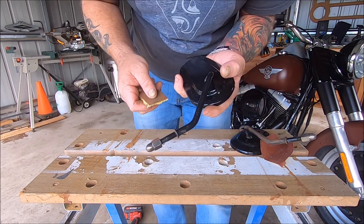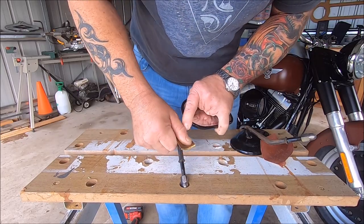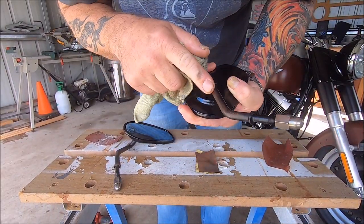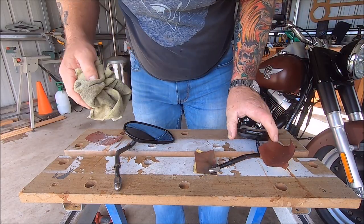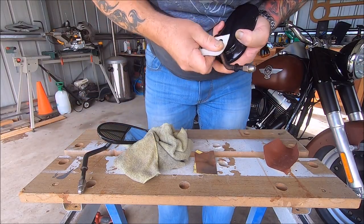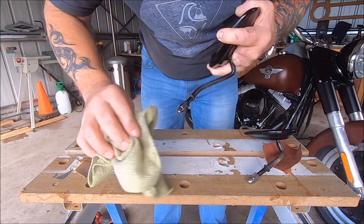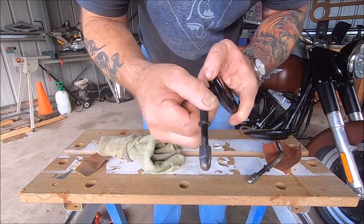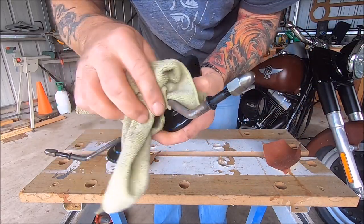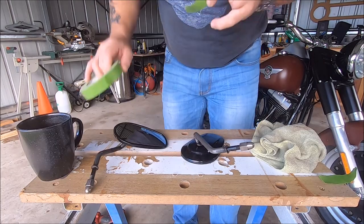This other side is not too bad as you can see, so we'll just scuff it up a bit so the paint will stick better. I'll give it a wipe and see what we've got. That one's very nice — not too bad either. I might just scuff it up a little with rougher sandpaper. Okay, so we've got them scuffed up. The one with all the rust on it — that rust is now gone. I'll just hit it with a bit of finer stuff and get it ready for painting.